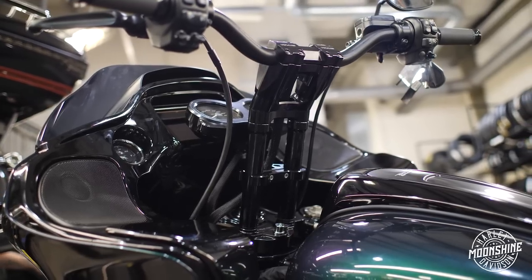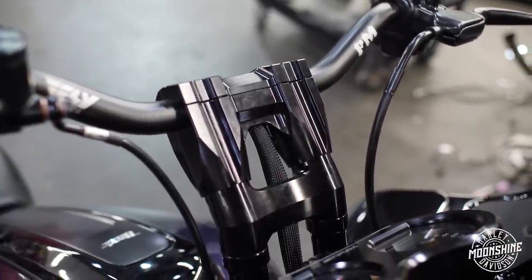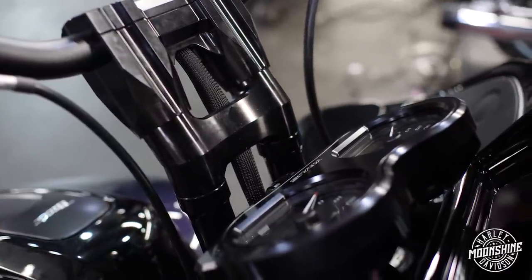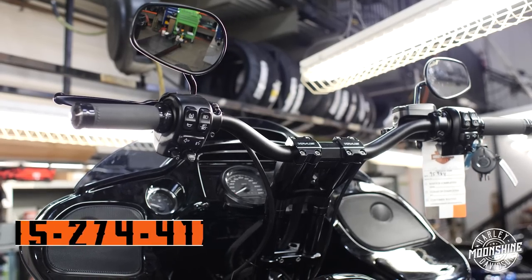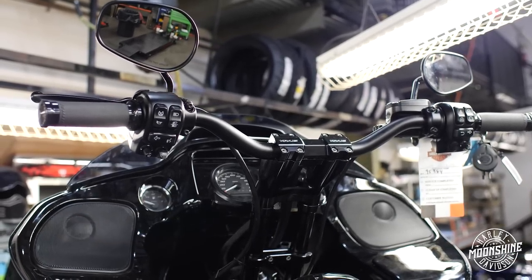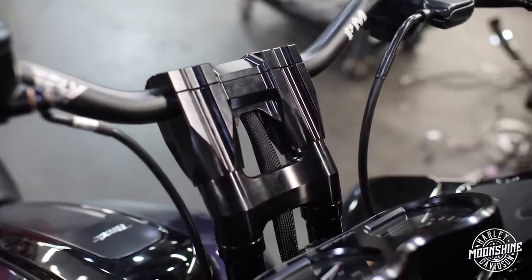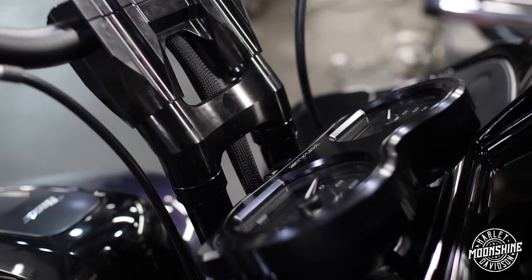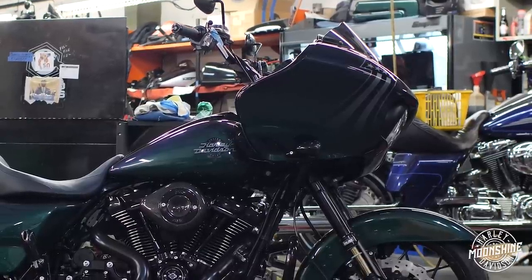On the 21s, something new from Harley is they've converted the clutch back from hydraulic to a cable clutch — which I prefer. When we do our clutch cables, we don't do the two-piece like Harley comes from the factory. That setup is easier and cheaper but we want a stronger clutch line. We're running performance clutches in our builds and don't want a failure — fewer pieces in that clutch line means more robust. We have custom one-piece clutch lines made from your hand control all the way down to your transmission. Most times when you go over 12 inches on handlebars you have to do the lines anyway.